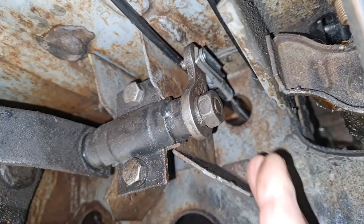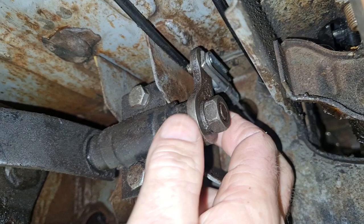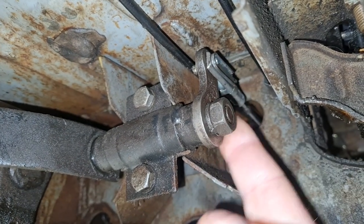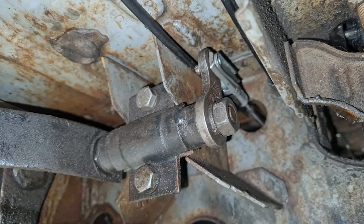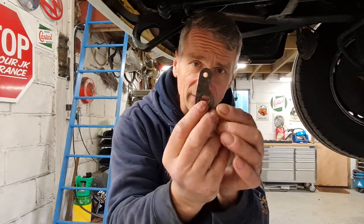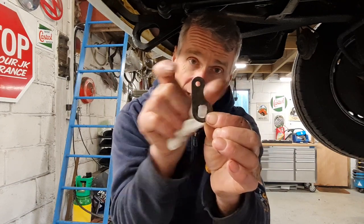So I'm at the front of our bus and I think I've found the problem. This crank arm that's connected to our pedal lever — I think this crank arm is round the wrong way. At the moment our cable is fixed behind our pivot, whereas if we turn this round our cable will then be in front, giving us more adjustment at the rear. So the crank arm was fitted that way round with the pivot in the centre and the cable connection behind. If we turn it round, now our cable connection is in front of our pivot point, extending our cable length.